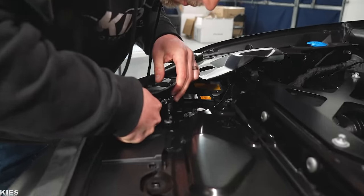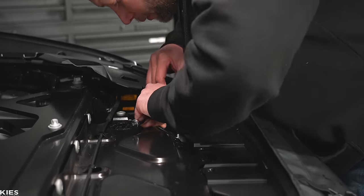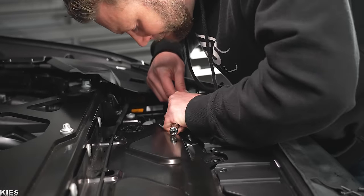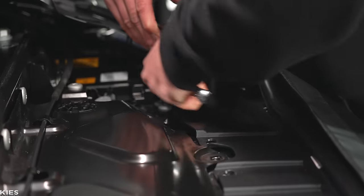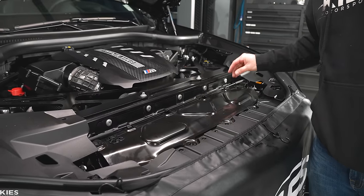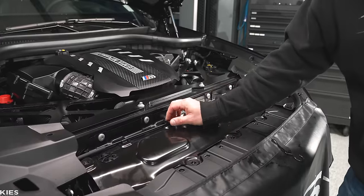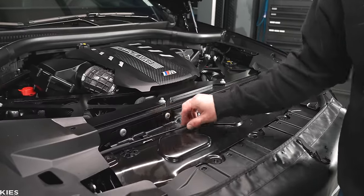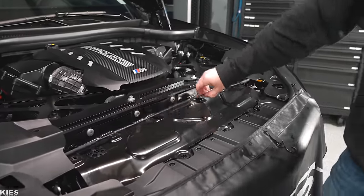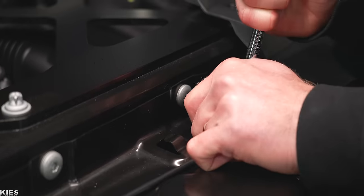Then, while we're here, I'm going to get the one that's hidden away, and I'll get the one hidden over here on the other side. Now, while this is still relatively held in place, what you want to do is very carefully unclip this line — this is what controls your hood latches — we're going to need to move it out of the way. At this time, we can take out the top ones.